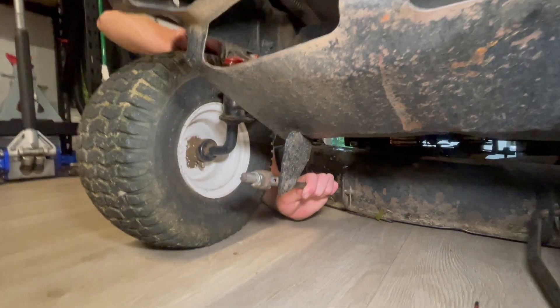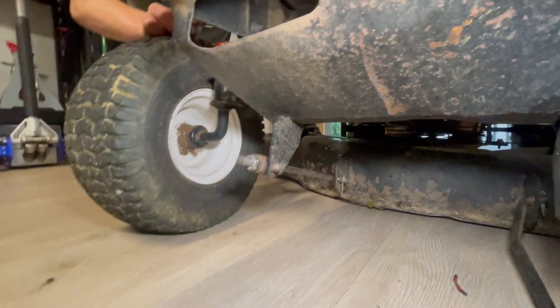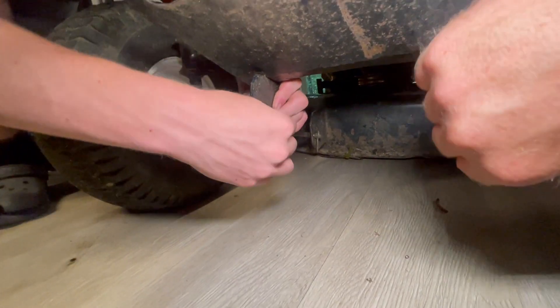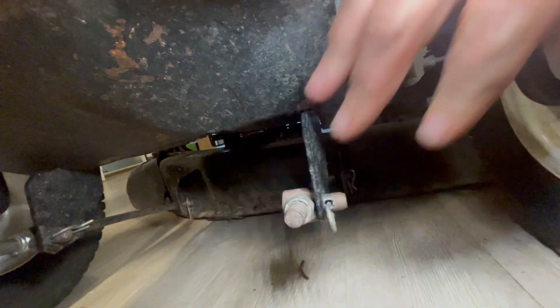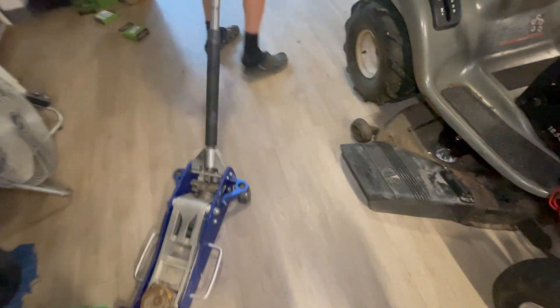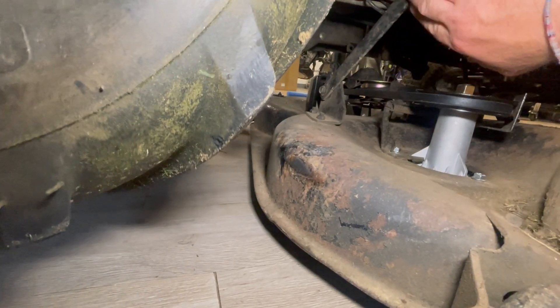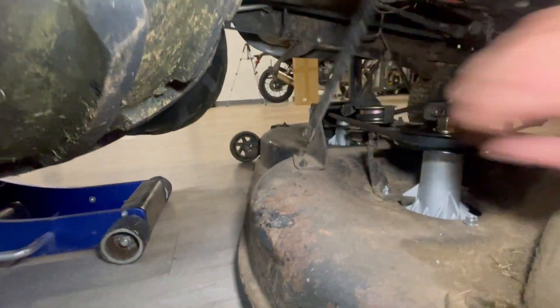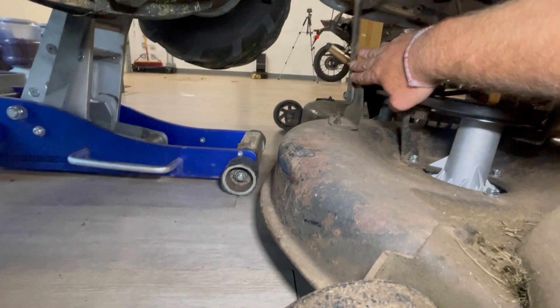Installed the drive belt onto the shaft, here come the front links. This deck is definitely more difficult to install than other models, say a Cub Cadet — simple pins, simple lineup. After doing that, I forgot to throw this bar to the other side, so grab a jack, jack it up, throw that bar to the other side, and lower down.